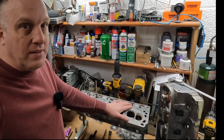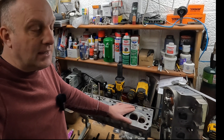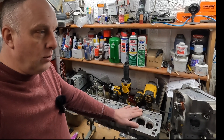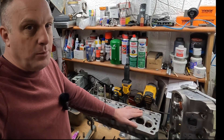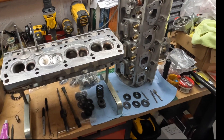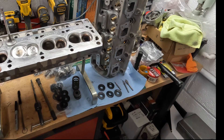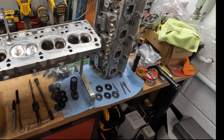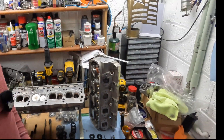We're going to get these heads whipped into shape — it's a lot of money's worth of parts, but these will be a really, really good set of heads. The intakes are already port-matched to them, and we're going to be looking at 650–750 horsepower in that range by the time this engine is done. It's going to be a 402 cubic inch stroker — standard bore, brand new block, Trick Flow heads with a Vortec supercharger blow-through setup and a Holley Sniper methanol injection.